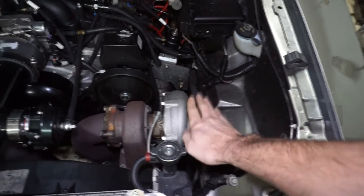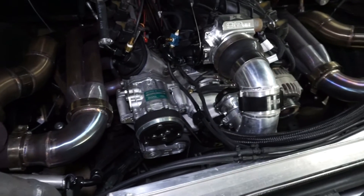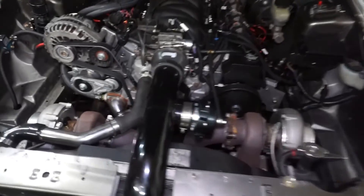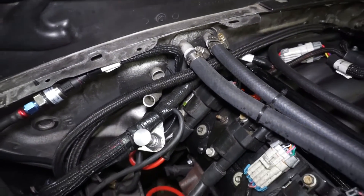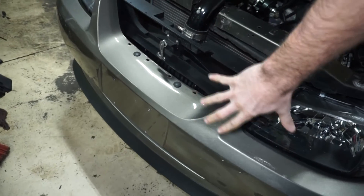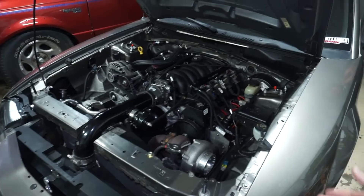The owner wants a list of what it's going to take just to repair and correct things, and also a list of what I would do if I had my way, so we might meet somewhere in the middle. Brainstorming: moving the turbo placement, kind of flipping them around and putting the turbos up higher, bringing the exhaust down — that would free up a lot of space to bring the lower radiator hose this way. There's a lot of room here for the Holley mid-mount stuff. This is the Holley mid-mount accessory drive — everything's nice and compact, and he liked this a lot when looking at it. It might not really be in the budget since it doesn't need to get done, but it also offers the ability to put AC back in eventually. It still has the lines for the evaporator and all that, so I think it has all the factory climate control. Another thought is to upgrade the trans cooler to a true cooler because the front of the Mustang doesn't have a whole lot of air opening, and a bigger cooler might be better.